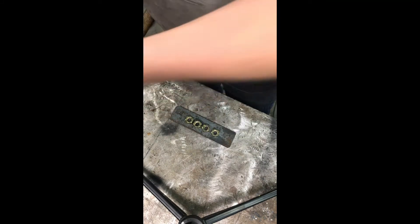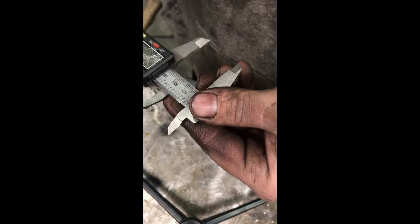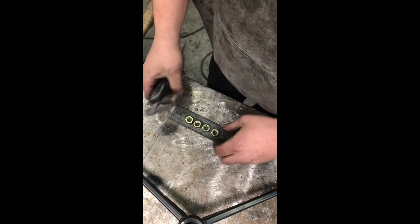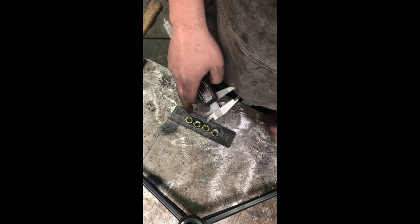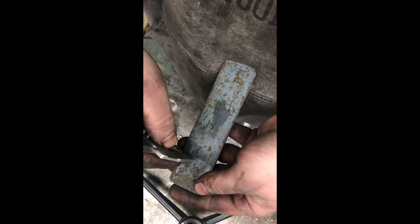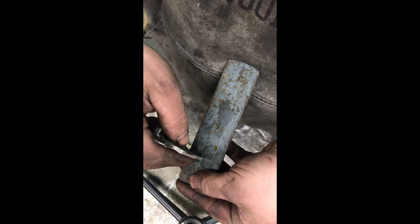Yes, I know the caliper is broken — it works. So that's a 15 millimeter opening... actually that was 30, so we're going to 15. I know that all four cables are gonna fit because these are the nuts off of the cable, so they're all gonna fit within that opening. I just want to make sure they're gonna be in a nice line, so I've got my caliper set to 15 and I'm just gonna go off of my straight edge here.